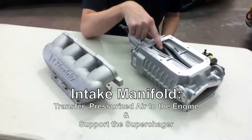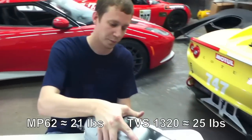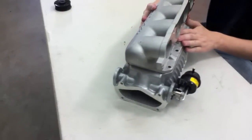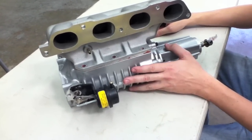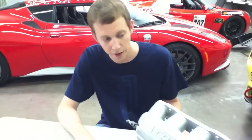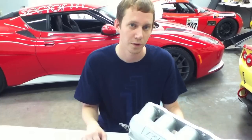The next component in the system is the intake manifold. You need a system to connect the air exit of the supercharger to the entrance of the engine to get the air into the motor, and it also has to perform a couple of other functions. In Lotus applications, and what is usually common in most engine applications, the intake manifold actually supports the weight of the supercharger. The manifold is bolted to the cylinder head flange and the supercharger is bolted to the manifold, so this is a structural component. It has to be capable of withstanding not only the structural loads of the blower, but also the pressure and temperature inside it — which is why you usually see these as relatively thick castings. Within the intake manifold family you'll have two basic types: one set up to be non-intercooled, and one that will have the provision for a heat exchanger to intercool the system.